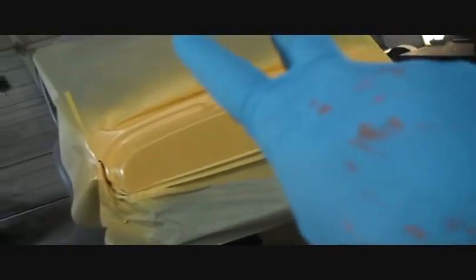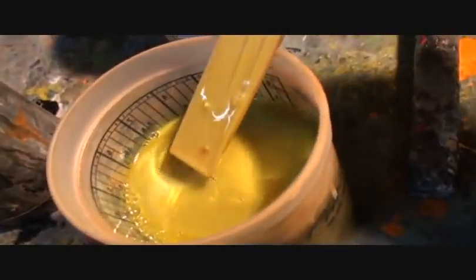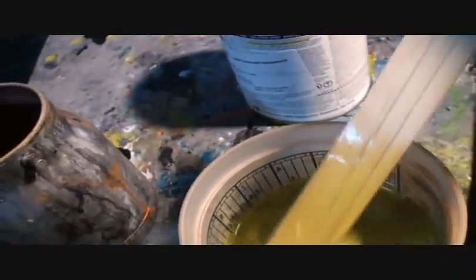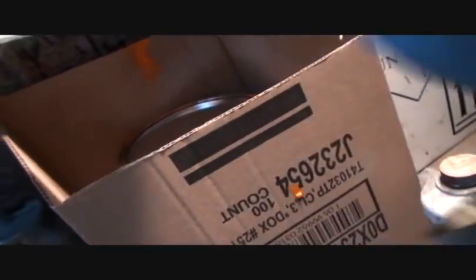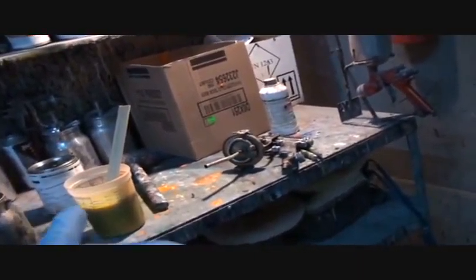Once we get the tri-stage on it, this is the paint that actually matters. It's very important that you mix that paint. If you look at it, it's a pukey — it looks almost clear when you pull it out. If you look right there, you can see trash on the stick — that's a good example of why you should always use a good strainer to strain your paint and make sure you don't have trash in it. That is actually the yellow — the greenish yellow that's going to go on top of our orange base. You really need to remember to mix that paint and track how many coats you put on and how thick it is.